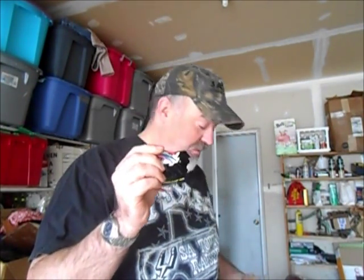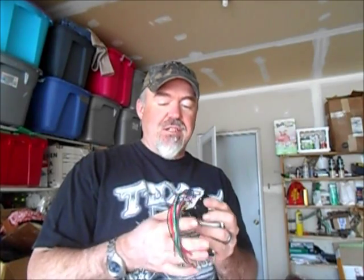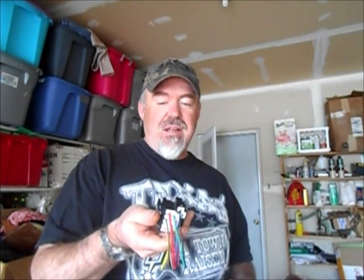Today we're going to be working on the 1990 Cherokee. We've got to replace the headlight switch. We also have to replace the headlight switch connector, which is this little plug that plugs into the headlight switch underneath the dash. Now on the Cherokees, they did a really poor job designing these, so the full current of the lights is going through this switch and they tend to melt and bad things happen and they fry out the headlight switches.